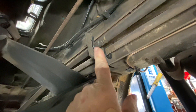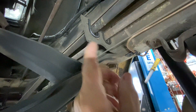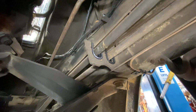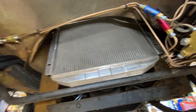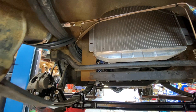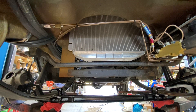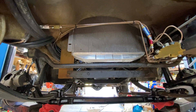We put some U-transmission shift rod U-bushings in here. They're pretty easy to install — you just lift this up and pop those in. That helps a little bit; it doesn't take away all the play of these long shift rods going back, but it does help. So that is pretty much it. We're going to probably do some other work on this van, but we wanted to make sure that this whole front end was taken care of. I'm going to cut the video and then come back and show you some of the parts that we used along with a few part numbers, so stay tuned.